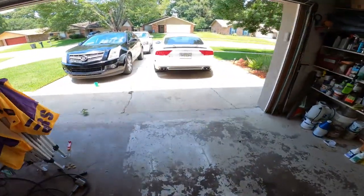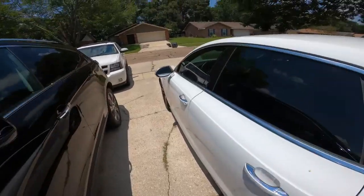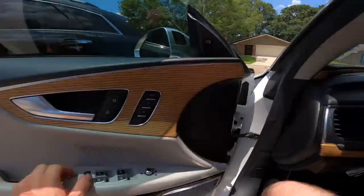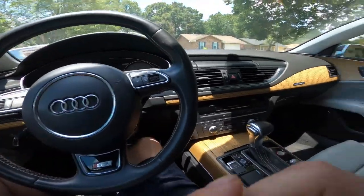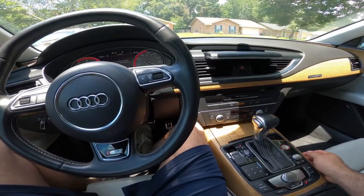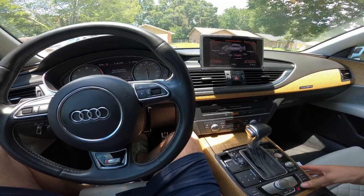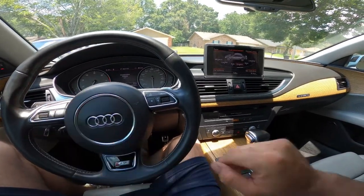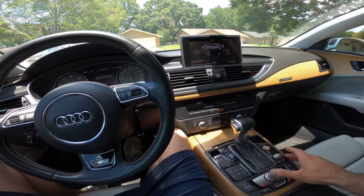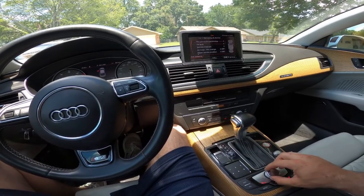Alright guys, one more thing. Almost forgot. You got to reset your service interval. Let's see. Go ahead, start the car. It's going to bring everything up. Press car. That damn buzzer. Press car systems, bottom left. Service and checks. Go down to service intervals.